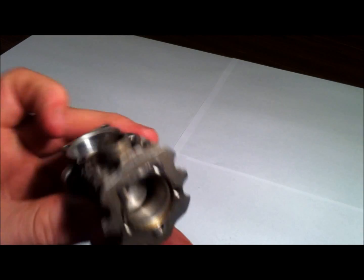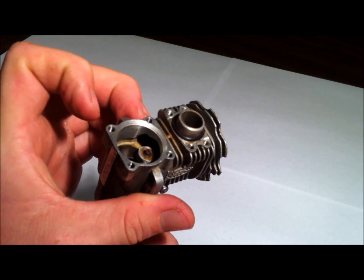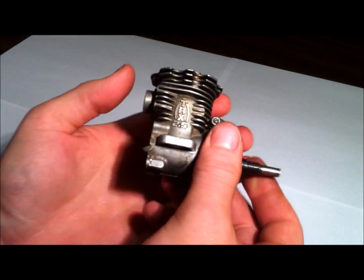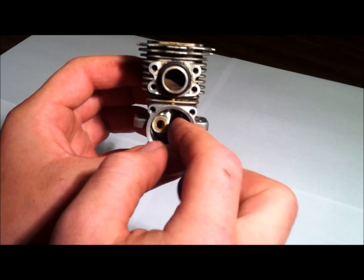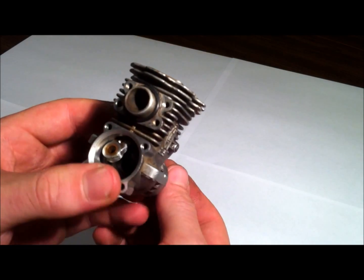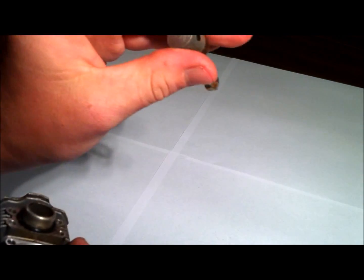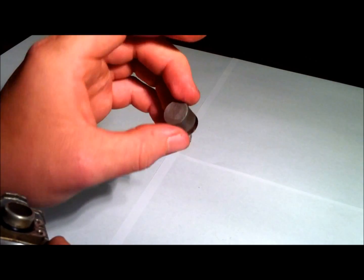Next, you got the little piston and the rod in there. I took it to top dead center, like so, took it and just hit it like that, slid off the little shaft of the crank. Took my crank, moved it down a little bit, and just slid it right out. There's the piston and the rod — make sure everything moves nice.